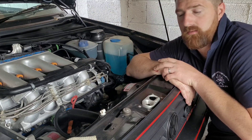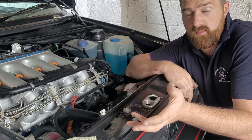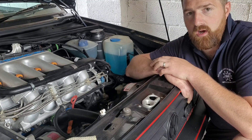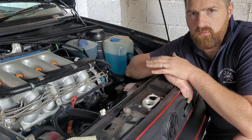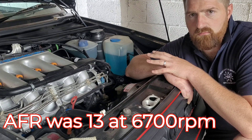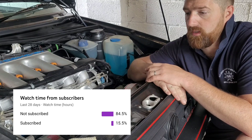So to summarize: I've shown you how to do the regulator modification — drilling the hole and the principles behind it — and I've shown you physically with the engine running. It warms up in literally two minutes and you can see the pressure rise to where I've set it. Screwing clockwise increases pressure and anti-clockwise reduces it. Mine is set at about three bar, roughly 40 psi, which works perfectly. Generally you drop from 50 psi down to between 35 and 40 psi. The air-fuel ratio on the rolling road is about 13:1 at redline. Hope you like the video — please leave comments and subscribe to keep up to date.